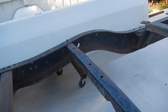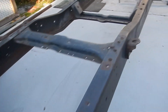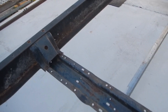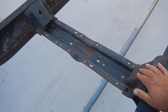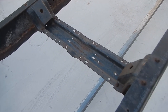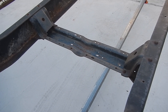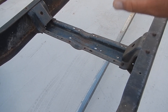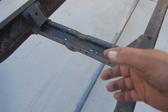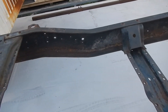Except for two bolts on either side. This is the upper shock mount right in front of the spare tire. The last bracket — this comes out, it just gets flipped. This bracket is the carrier bearing support bracket. On the D-series trucks it's mounted upside down like this, and on the W-series trucks it's mounted right side up. In a W-series, the carrier bearing hangs; in a D-series, the carrier bearing is supported. The frame is really in good condition.